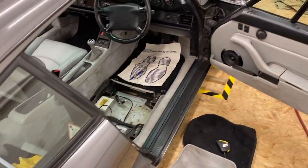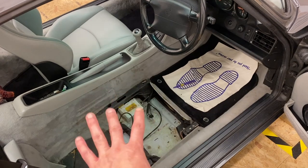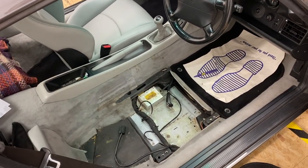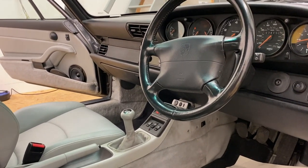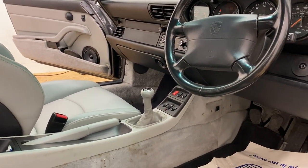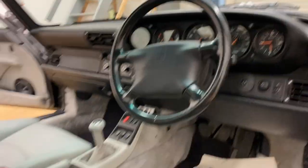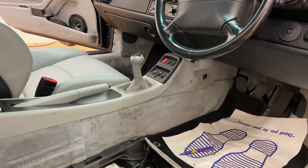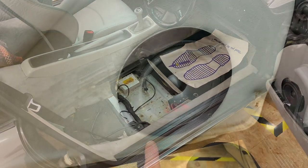The rear speakers are adequate — I've had a listen and they sound okay, so we're not going to change those; we might just run new wires to them. Obviously, now we're amplifying the system with a DSP we'll be able to time-align it all properly and run the rear speakers in what's called differential rear fill, so you don't get too much vocal information coming from them. The head unit already has hands-free, which is handy.